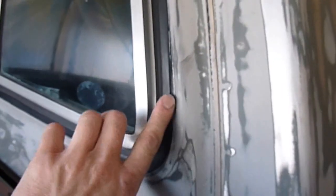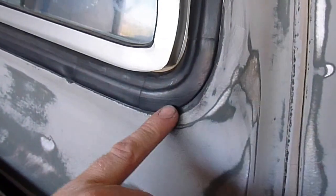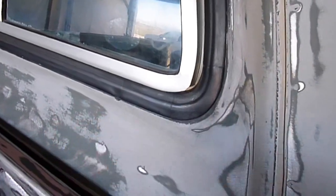Just like I did on the front, you tape over that with a little bit of overhang and then you're able to tuck that back in. Now instead of having the seal laying directly on the metal, you'll have that little quarter-inch lift. Go ahead and back-mask over the top, fold that edge underneath by the rope, and then you have a lifted edge so you do not have a hard edge — the paint can bridge over there — and it just makes it a lot easier to mask off and makes the whole process a lot easier in the long run.